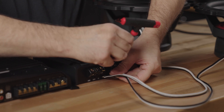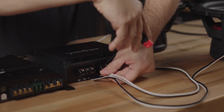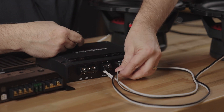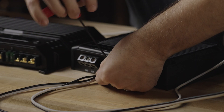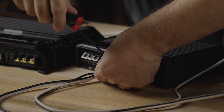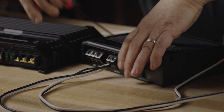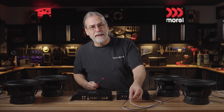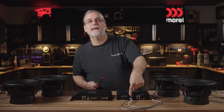Now remember, you also have to hook up power and ground for your amplifier. Be sure to get yourself an amp wiring kit that's appropriate for your amplifier if you don't have one already. So there's my positive going in, and here's my negative going in. Snug it down tight - make sure it's real snug and tight. Got those tightened in. Now that is a parallel connection to this amplifier. I had to join the wires to each other because I've got one set of terminals.